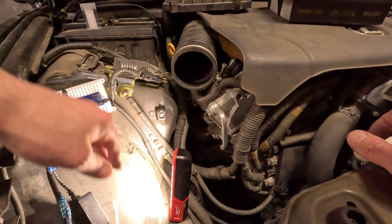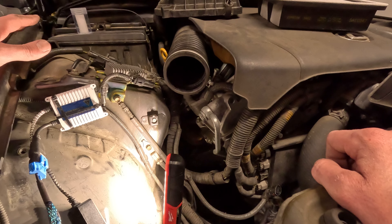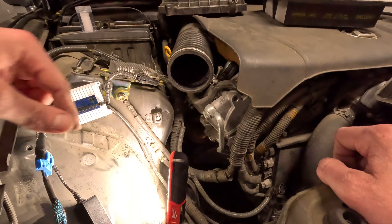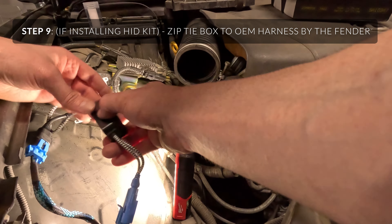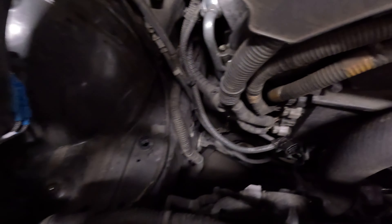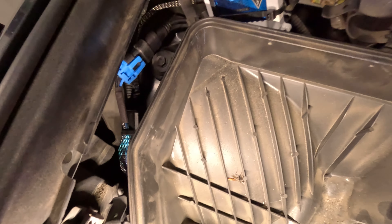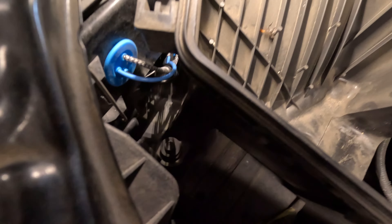That one's fairly tight — not going anywhere. You can also zip tie around this inner liner here to have it balanced a little better. Quick note: when putting the airbox bottom back, it has a peg that has to go in that hole, which may cause a little issue when lining it up. On the passenger side, that's zip tied in there nicely, nice and loose over everything, clearing and not caught. Just make sure the wiring's clear on the bottom before you tighten these bolts.